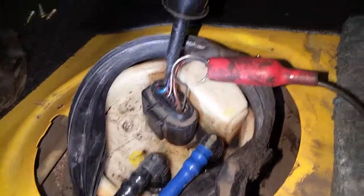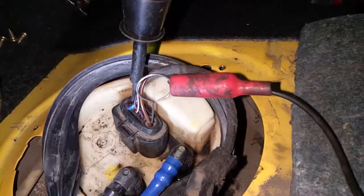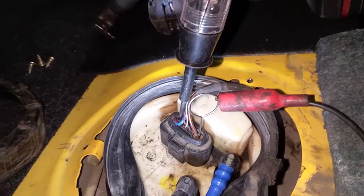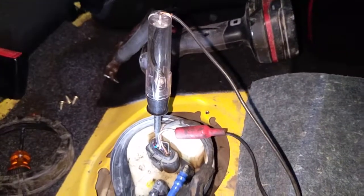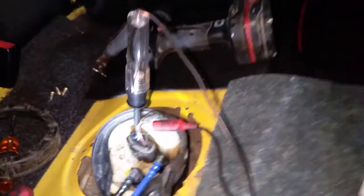And then in the back, I've undone the fuel pump but its connected lines are connected and also the electrical portion is connected. I also put a test lamp or test light just to get a visual when I put the ignition on.